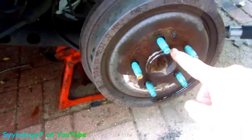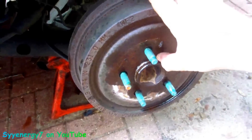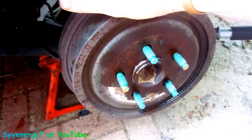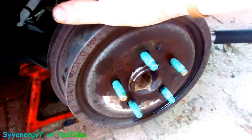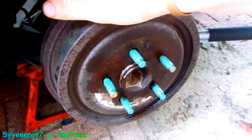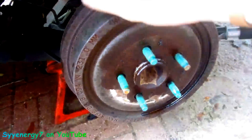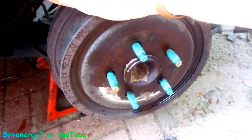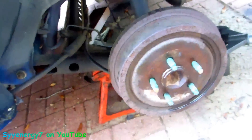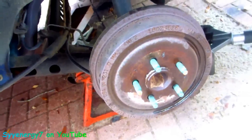You can get your propane and heat up all around here. It's not so much that it expands the metal - it actually causes the rust to break down. It does help the rust break down a little bit. Heat works pretty good with bolts, but these have been on here for 14 years, they've been on here a long time. It's some kind of government car, low mileage, but I'm sure it was out in the weather.